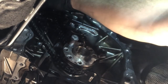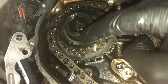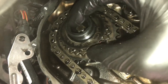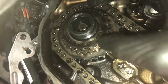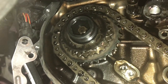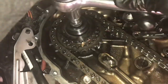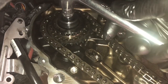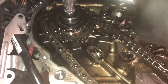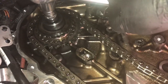I'm going to get this pulley off up here. So here's the high pressure fuel pump pulley. Here's the special tool that I inserted into that thread - the idea is that as you undo the actual bolt in the normal anti-clockwise direction, it will push against this tool and pull the pulley out to release it from its taper. So on the high pressure pulley now, the bolt has reached the special tool so I'm going to continue undoing it. I need to stop the crank from turning and pull this until it pulls the pulley off.